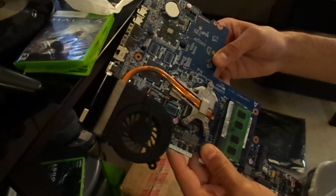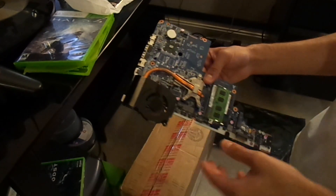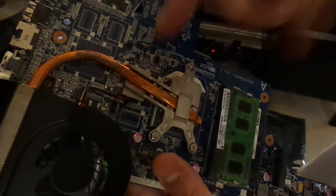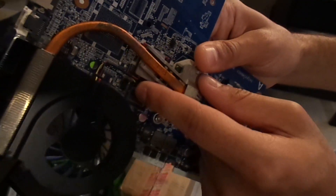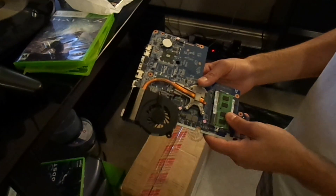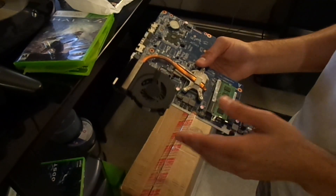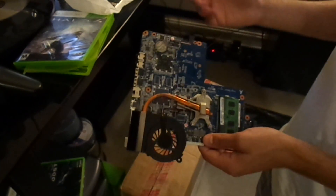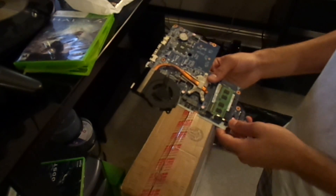This is a motherboard that came from an HP Pavilion. I actually upgraded a laptop component for my friend and we got a whole new chipset. This is an AMD board, and as we can see here, this is the CPU which is exchangeable and upgradeable to an extent of the socket. That is the GPU there, which is integrated. One of the main problems is whenever you are going to be doing gaming or wanting to expand a computer over time, you really have no leeway with laptop motherboards because everything is so integrated. People wind up just upgrading the hard drive to a solid state, maybe the RAM, and on a few occasions the processor.